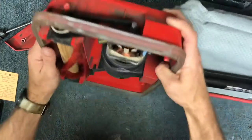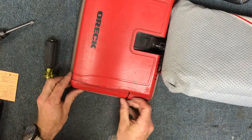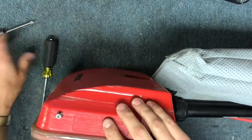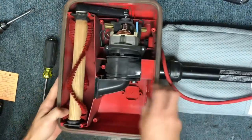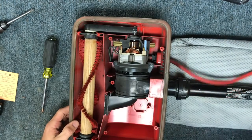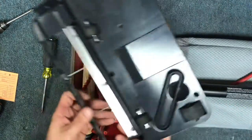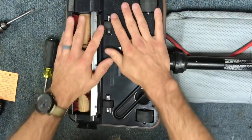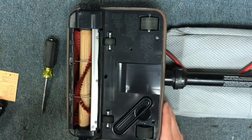Once you get your belt put back on, if you took this panel off, you're going to slide it back in place and put your screw back in on the side. Then check right in here at your intake area — just make sure there's no debris in there. You should know whether there's a clog because if the vacuum was picking up on bare floors, you do not have a clog, but that is where you'd want to check for a blockage. Go ahead and lower your base plate back on, and then the screws will just sit right back in place.